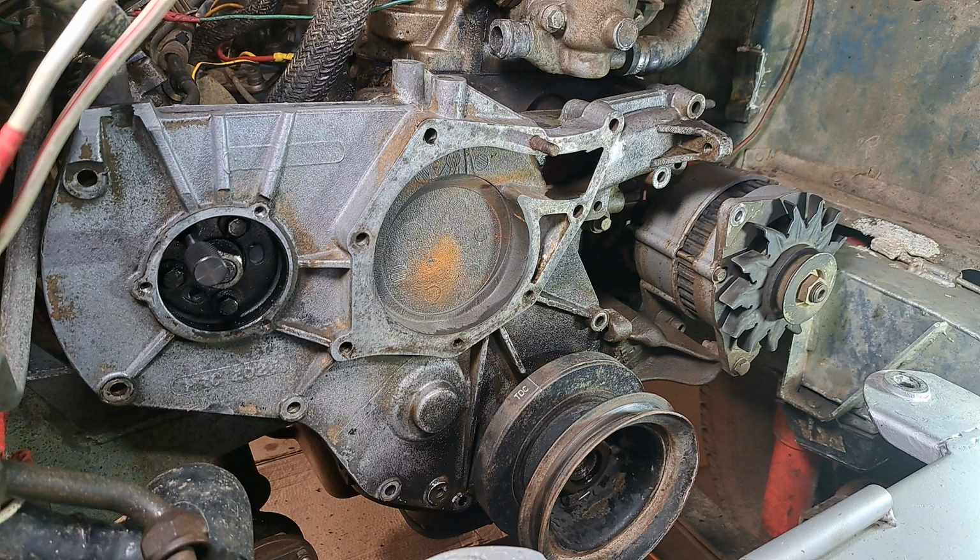This is obviously done better with the engine on the floor or a bench or in a stand, so you can move it around and get to it easily, because I can't get to the flywheel locking pin because the chassis sits across it. So I've got two or three options. Take the engine out, which I'm not about to do, just put a pin in and drill a hole through the chassis, or go with it as it is. There is one other option which I need to look into. At the back of the engine, on the bell housing, there's a bolt at about 11 o'clock, and I'm going to take that out and have a look in there, and if I shine a torch in there, there should be two marks looking at me. So that is going to be my next job.